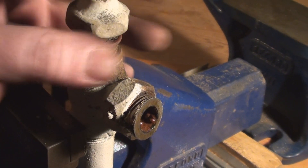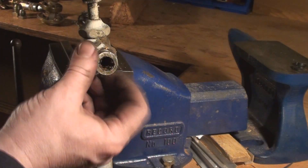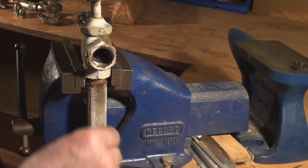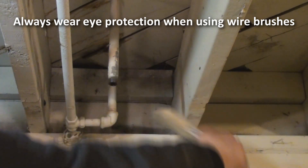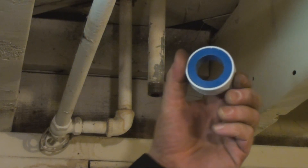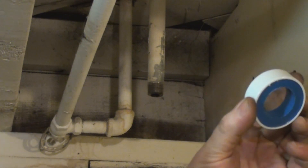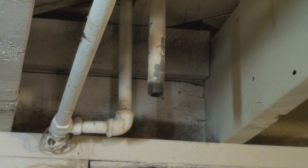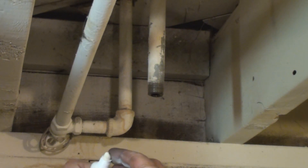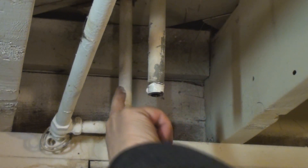Just going to drop that in there and spin the pipe out. Clean up the threads — make sure you're wearing your eye protection when you do this kind of work. Now this is the point in the repair where a lot of guys will reach for their Teflon tape or silicone tape. I was trained not to use this stuff. For sealing pipes I use pipe sealant — here's Oatey brand — what I use as pipe dope, pipe joint compound. The reason is that in fuel systems, Teflon tape breaks down and enters the fuel system, getting into things like fuel injectors and plugging them up.